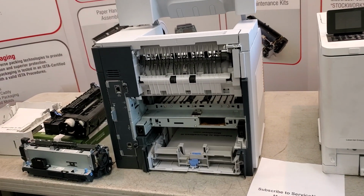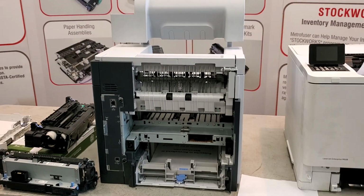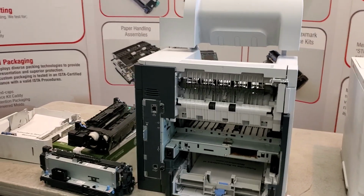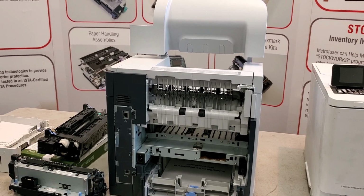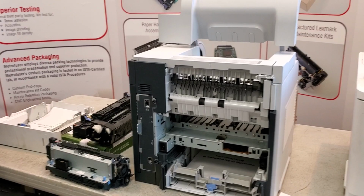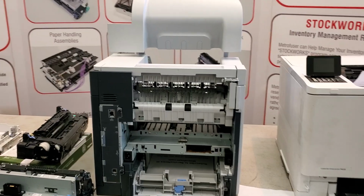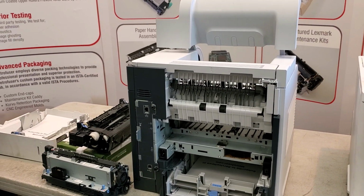If you happen to have a recurring problem, it may be time to change out some printer parts. Whether it be the fuser or maintenance kit, there's a number of rollers and separation pads that may be causing the malfunction. There's things that are called maintenance kits that can be replaced, which have the top worn parts, and along with the fuser, that you replace those, and that'll get the printer back up and running.